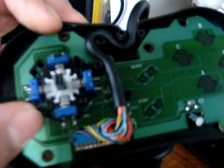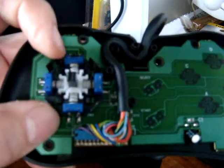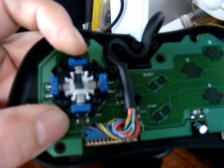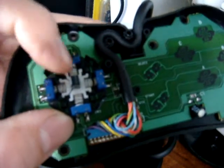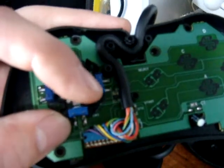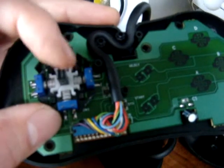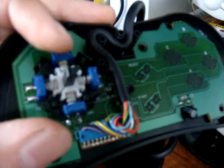This is an interesting concept. The bad point about this is that with a lot of fighters — NeoGeo had a lot of fighters — with these joysticks, if you can imagine taking a piece of metal, like even taking the tab off a pen and bending it back and forth really quickly, you're going to create a lot of weakness in the metal, and the metal is going to eventually break from too much flexing. The same thing happens with these switches. Over time, the constant clicking back and forth will wear out the inside of the switches, and you'll be left with the directional pad going up and down but left and right will be really bad — it won't click, or you'll really have to ream on it and it'll only somewhat move. That's just from too much clicking — the pads wind up sticking together or breaking the contact points on the inside.